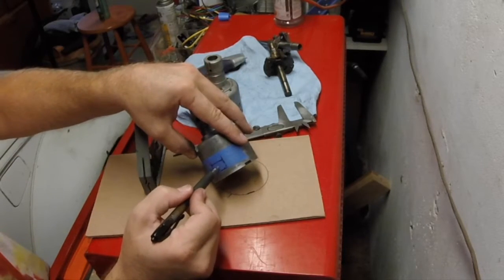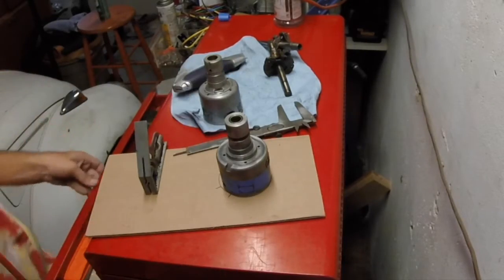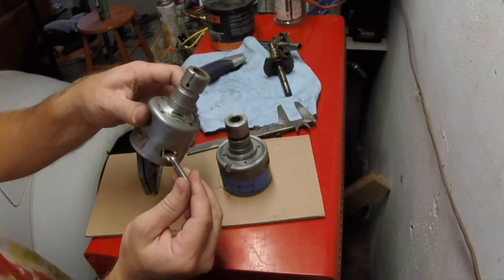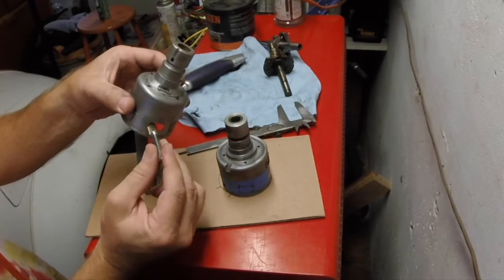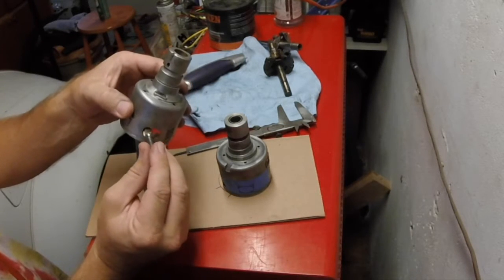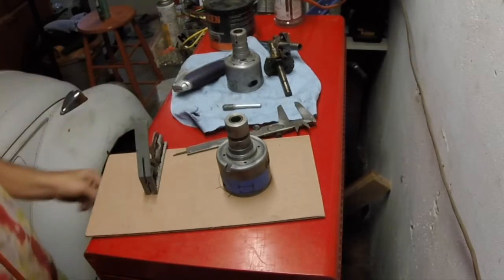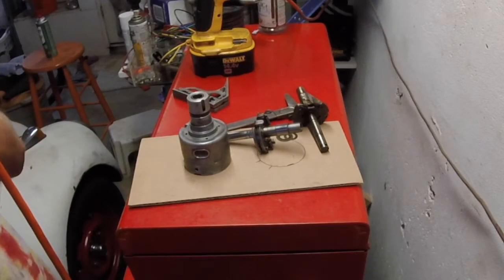So now I'm going to drill a hole there, whittle out the difference using a burr bit. Here's the burr bit. I am fortunate, it is smaller than the hole that I need. So I'm going to drill a hole roughly the diameter of that. Get this in there, whittle, whittle. We'll be good to go. Okay, so 7/16 drill bit did it.